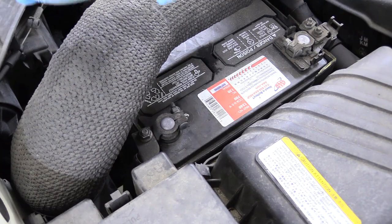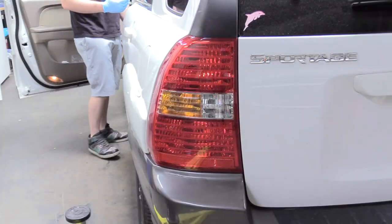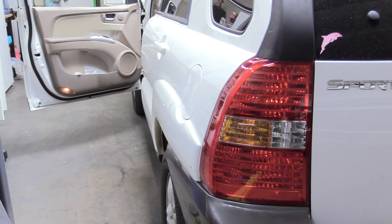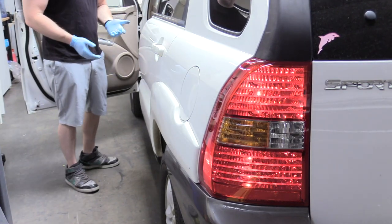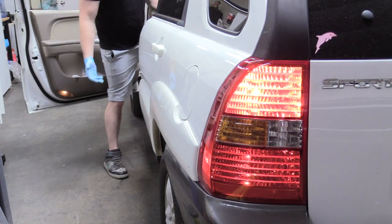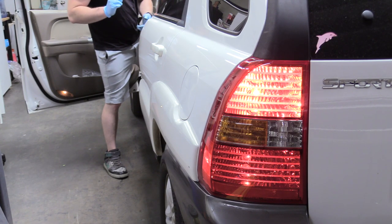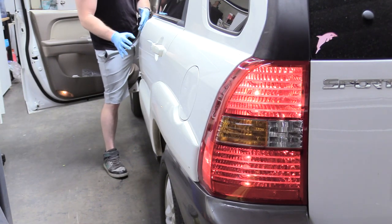Before we take this on the road, let's check the rear to make sure the brake lights are coming on. All three of our regular brake lights are working. I also like to turn the headlights on and push the brakes to make sure the lights get even brighter when you press the brake pedal, because sometimes if you have the bulb in backward it'll work the other way around, which isn't correct. The way I have it here is correct.